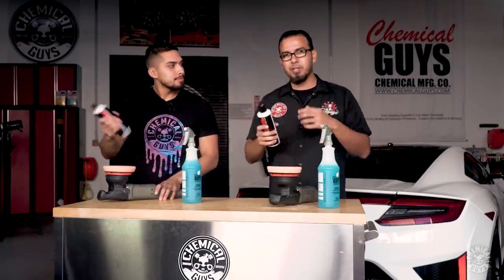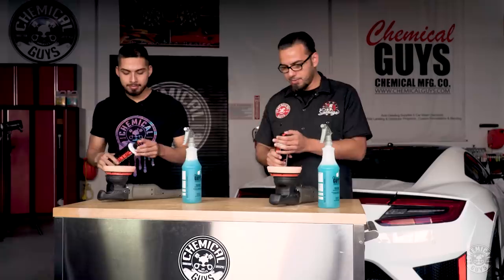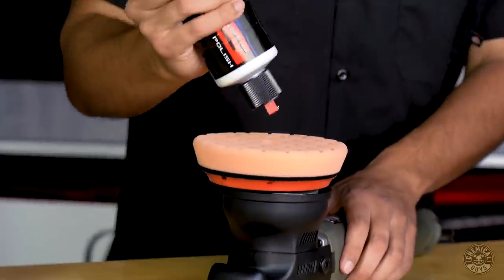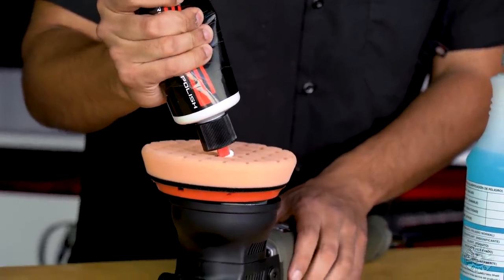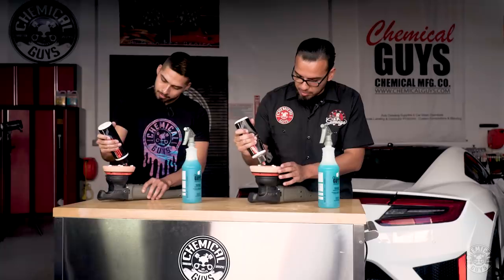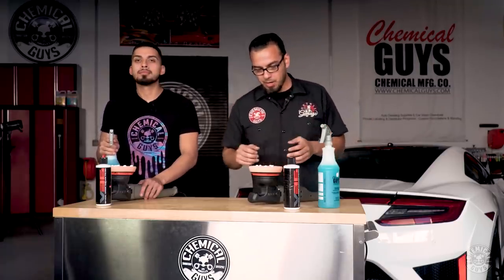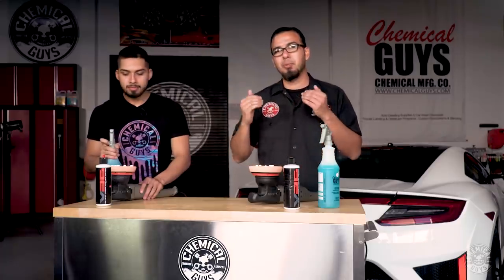To begin we're shaking up our V36 to mix all the chemicals together so all the abrasives have a chance to actually work into the polish. We're going to use about five dime-sized dots for our pad — that's about the size of one hex — for about every two by two foot panel. We'll spread it out on the lowest speed setting so we have even coverage, then bump it up to speed setting six on the dual action polisher so we actually break it down and give it the proper work time. If you're new to polishing: make sure the machine is completely flat at all times so it's not cutting into the paint at an uneven rate, keep the machine moving about an inch per second so it doesn't get hot in one area causing burns or marring, and lastly make sure the polish has gone completely clear before you pull off — this way it's completely broken down and has had proper work time to remove any scratches, swirls, or in the case of this car any old coatings.